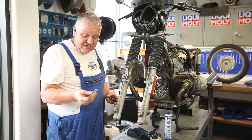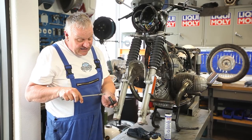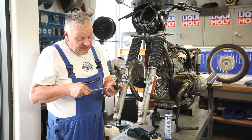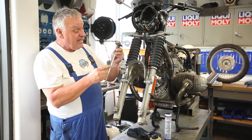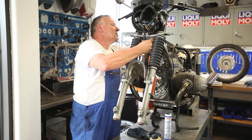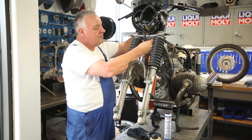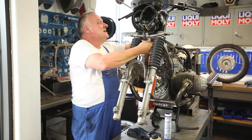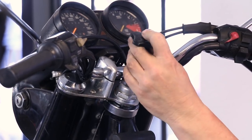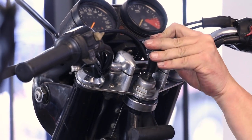I'm going to put the steering damper assembly back together. This rod has to go in — you can see it has a flat on it, and there's also a flat inside which is facing the two. So you can get an idea of where the orientation is so you're not fumbling around too much, and just stick that up inside there. Put it all the way in, and then there's a little plastic bushing that goes in underneath — center it — and a spring.